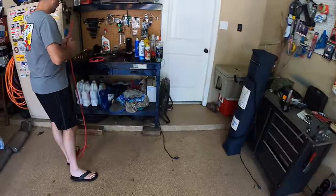That's the goal. But what we're gonna do first is make some battery cables, because we actually did try to replace the starter. And that old starter definitely is bad, but we thought maybe the new one was bad too. But when we hooked it up to the battery charger to test the starter, it worked. So that means that those cables are probably junk. They're sucking way too much amperage down, and that's just not gonna work. So we've got new battery cables, but we have to make them. Let me show you what we're working with.